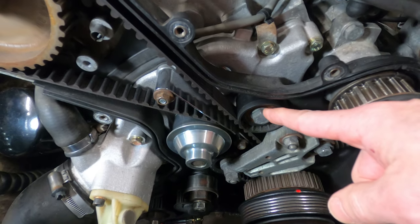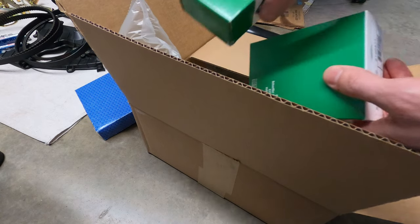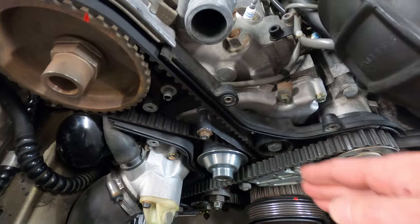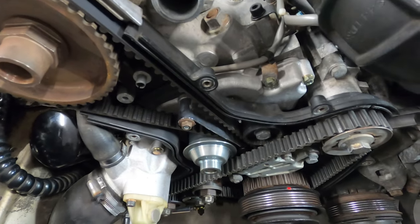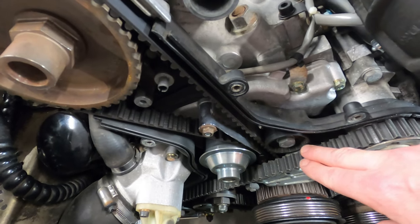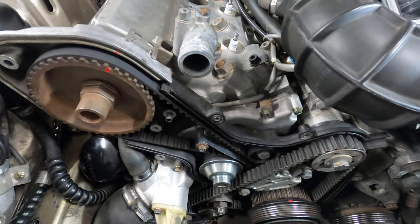As far as the rollers go, if you spin them and they're noisy, they should be replaced, and all other rollers are typically replaced at every other belt change. That said, the general consensus of the community, to include forum posts and conversations with enthusiasts, is that a 2 year, 30,000 mile interval is appropriate for replacement. Certainly timing belts have lasted longer than 30,000 miles. There are also examples of people saying that their belt failed just after 30,000 miles, so pick what's best for you. The belts aren't terribly expensive, so it's pretty cheap insurance just to replace them.